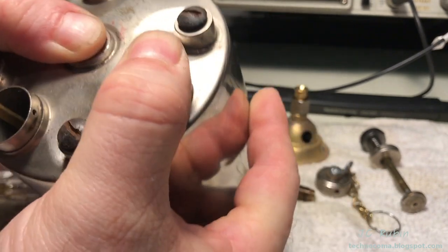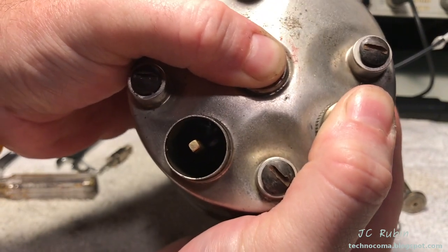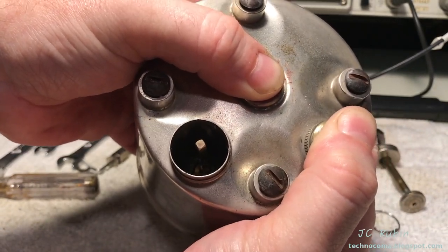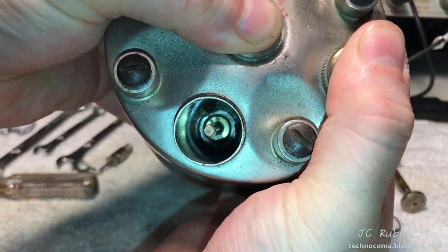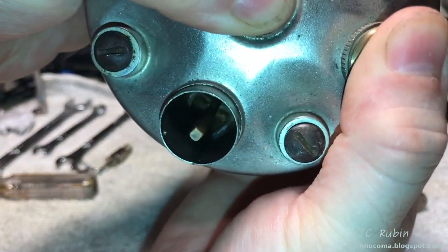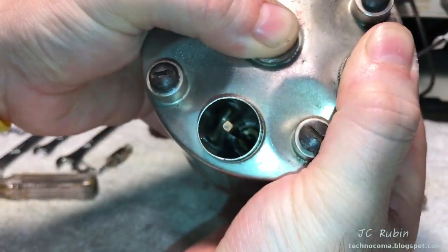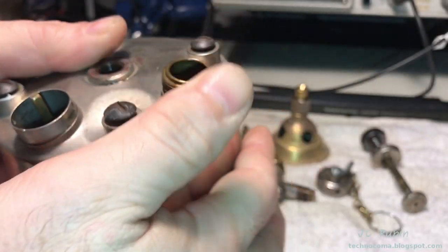I just want to see if anything is going to get through the check valve, so I'm just sort of shaking it towards the direction of the check valve, seeing what comes of it. Adding considerably more, laying it towards the check valve, waiting for it to leak if the check valve had failed, but I don't see anything coming through the check valve. It seems good. So now I'm just shaking for the purpose of agitation.